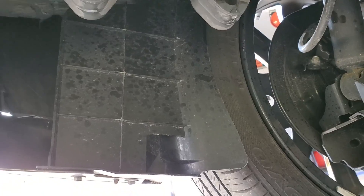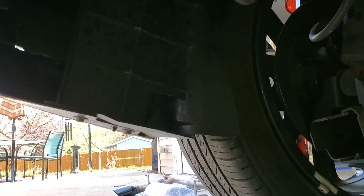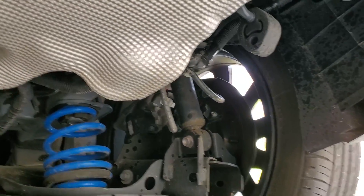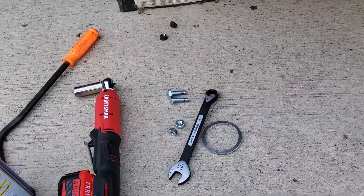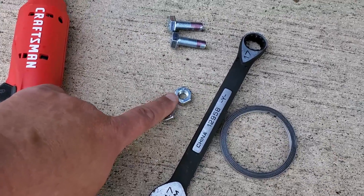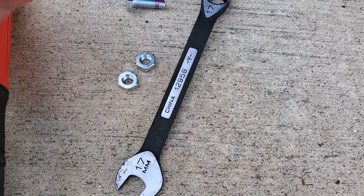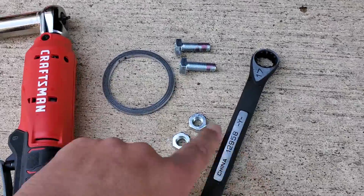You've got your hangers left up on each side, so I'll spray a little WD-40 on them again and on the stock hanger points, then we'll get the sucker hung. There's really not even any adjusting to do — it just hangs from the factory spots. Just a quick note: the new hardware included is actually a 17 millimeter nut and bolt. I put a little Loctite on it for good measure. This is the supplied gasket — it's like a crushed gasket. Make sure you have a wrench to hold one side and a socket to tighten the other side. I don't think there are any torque specs — just as tight as you can.